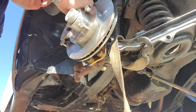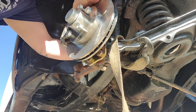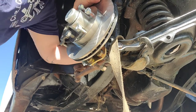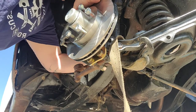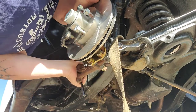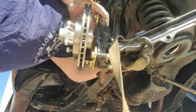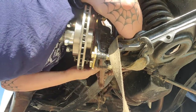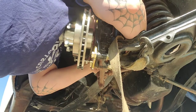A lot of times when you're getting a brake conversion kit you'll see 'universal' — don't go by universal, because it really does depend on your car. If you're putting a Mustang II front in on your car, like a lot of hot rodders do, most universal stuff is designed for a Mustang II front end. This is an old king pin front end — it's got a lot of steel and is nothing like a Mustang II front end. It takes a very special bracket to do this switchover, and Scarebird gave me that.